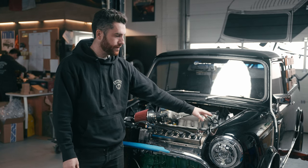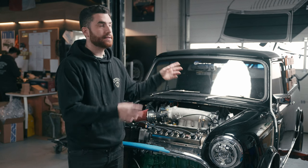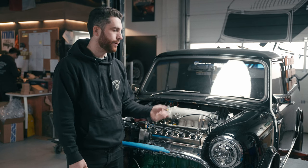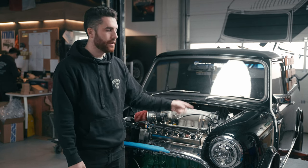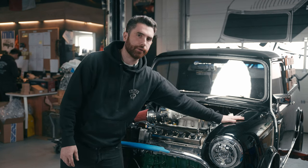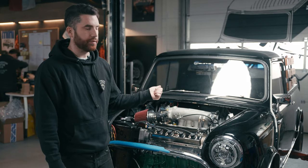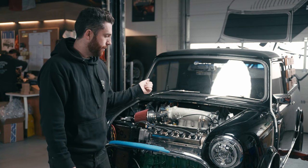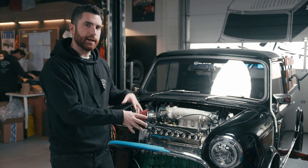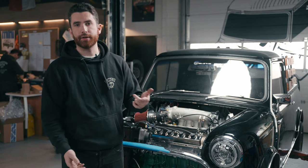The alternator setup on the side uses the mount that comes with the kit, but because this car needs a bigger alternator to run the electric air conditioning, we had to modify that mount so we could fit a 145-amp alternator tucked up in the inner fender right here. That should be enough amperage to supply the electric AC. We'll go over a little bit more of the peripherals and where we're currently at, but first let's talk about today's sponsor.